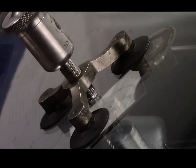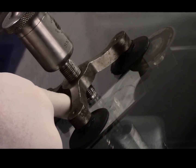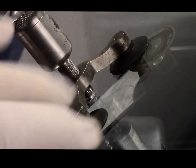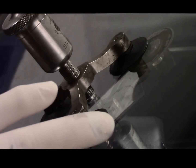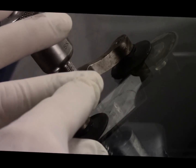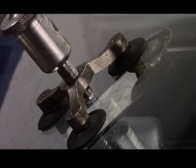What that's basically doing is sucking out the air that's inside the repaired area. Glass is actually made of three parts: glass, plastic, and glass. What happens is the outside part is fractured right here — air gets trapped between the plastic and the outer glass. So we need to get that air out before we inject the resin into it. Right now this tool is sucking the air out of the window.